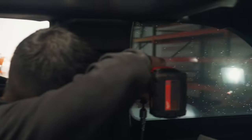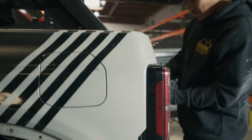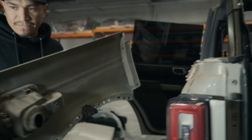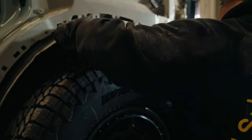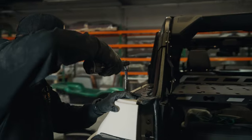The back is really similar. If you have a soft top, simply fold it up and peel it back to get to the bolts on top of the bed rail. If you have a hard top, you do need to take it off the vehicle to access the bed rail bolts. You're going to loosen the bed rail bolts — there are two in the door area and two hidden beneath the rear bumper cap — then pull the entire quarter panel off. At that point, install our custom liner, which is for the 5-inch and 8-inch kits. The 2-inch kit reuses the factory liners because they reach. Install the rear quarter panel, bolt that down, and once it's all fitted up with the liner installed, start installing the rear bumper cap.